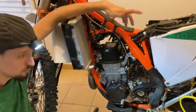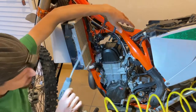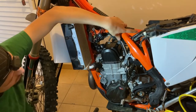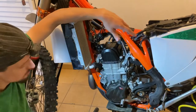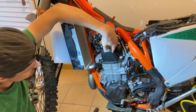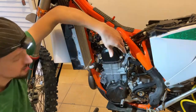Have some compressed air. If you don't have compressed air, have the tank off when you're cleaning so you can use a brush or sponge. Get the grime out of this area - there's a wiring loom in here that can get a lot of mud caked in. Make sure everything is as clean as you can get it, because you don't want specks of dirt getting into the valve train. This is precision machinery - it will increase the wear on your engine and get into your cylinder.